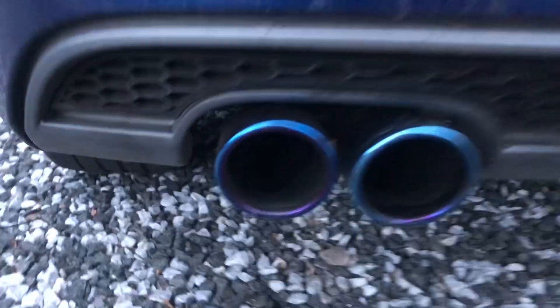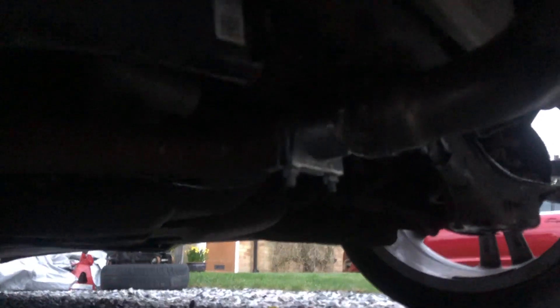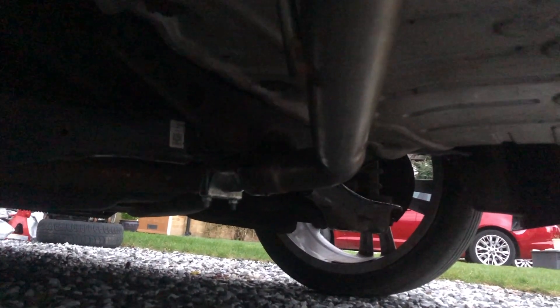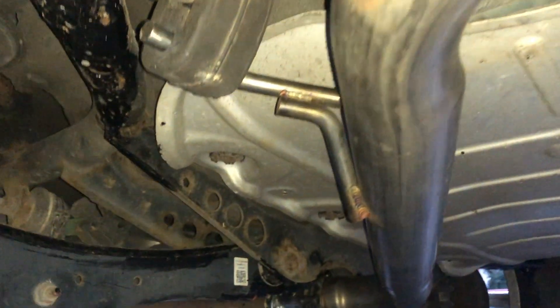The exhaust is installed - took me multiple days. This isn't a very coherent video. I chose to only install the back section and kept the center resonator. I just cut the pipe off with an angle grinder and then got a two inch to two and a quarter inch adapter - I'll show you on screen what I bought - which bolted up to the pipe, which is slightly bigger than that section. I used the original hanger with some spacers.